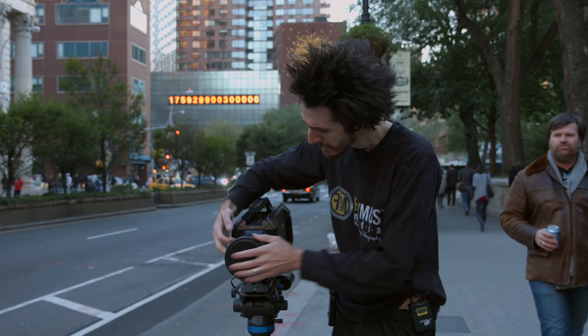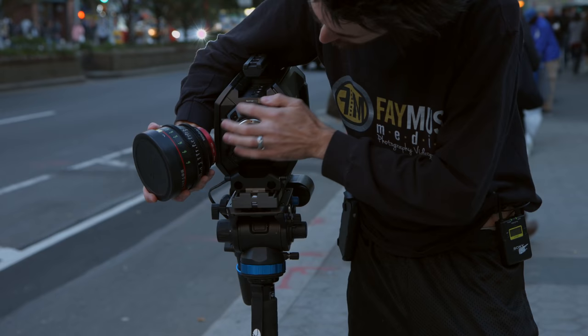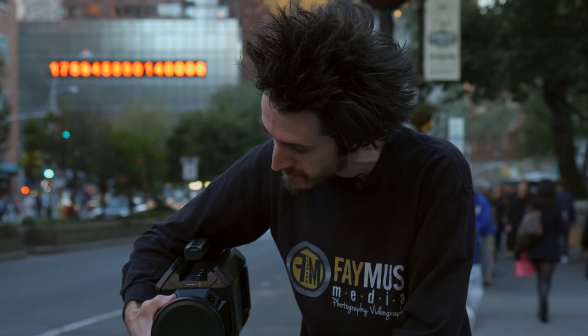If you take out these 4 Allen hex wrench screws right here, you can pull out the sensor assembly, which I'm going to take this lens off just for a second. These 4 screws here, you can pull this whole assembly off and the sensor is attached to a heat sink and a fan, which means when Blackmagic releases a sensor in the near distant future that has way better low light performance and shoots possibly 5 or 6K and possibly 120 frames a second, Blackmagic's just gonna send it to you in assembly and you're just gonna swap them in and out in 5 seconds, literally.